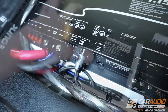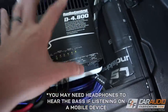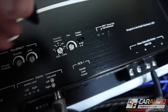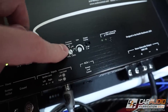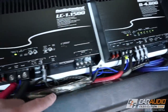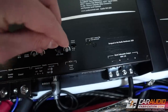The installation process is complete. Let's power this up, make sure everything's working, and then do the tuning process. We've got power, everything powered up correctly, and as you can hear, some bass. I've disconnected the mids and highs amplifier and the subwoofer speaker wire so we can set the gain and crossover. I'm starting with gain at the minimum position. For the crossover, we have adjustment from 30 Hz all the way up to 230 Hz — this is a 24 dB per octave Linkwitz-Riley low-pass crossover. If you're using a DSP or DSP-integrated amplifier, you can bypass this crossover by putting it at its maximum value and setting the crossover in your DSP software. That's what I'm going to do, so I'm turning this all the way up.